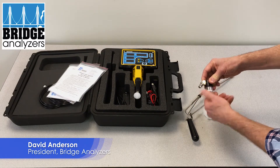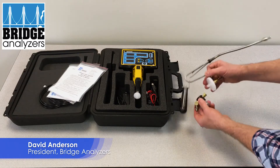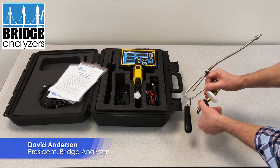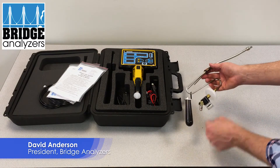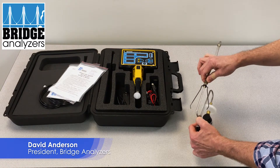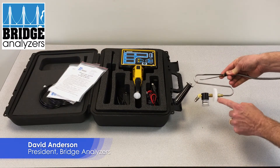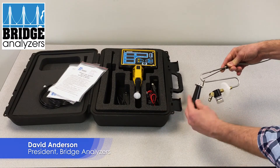Then there's the water bowl — you want to make sure you screw it on snug and you can feel it snug up to the o-ring. Then we can replace the water trap onto the 50 millimeter filter. Make sure it's snug enough that you're not getting any air drawn in through any of those fittings, because we want to pull strictly from the tailpipe. You can use a wrench up here to make sure it's snug. So the assembly is: probe, s-bend, 50 millimeter filter, water trap with a filter inside, and then the connection goes from there over to the analyzer.